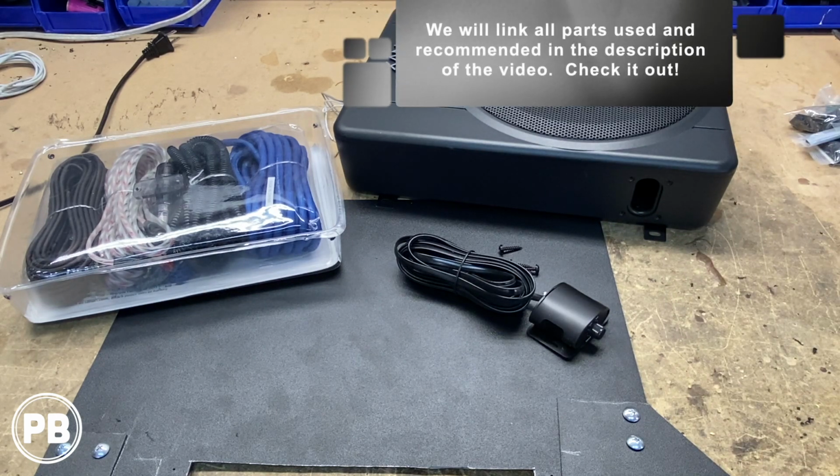Now to get that wired into the vehicle, you'll need a general amplifier wiring kit. We're using a new concept CCA 8-gauge kit. It's all it needs for about 200 watts. And we can link these parts down in the description.